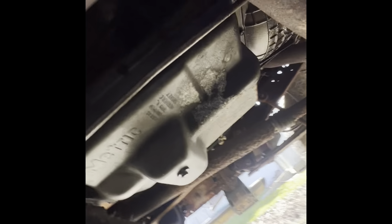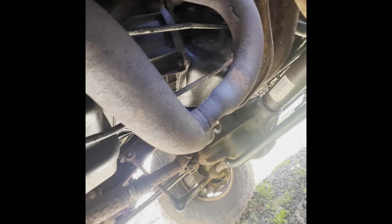Alright guys, now that the pipe is removed and it's drained pretty much everything — I'm just going to pull it. It still has a little bit leaking. You've got to pull it and work it — remember it has bends in it. Just pull it from the engine side, work it, and it comes right out. That's how you're going to feed the new one in, and she's out.